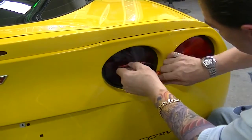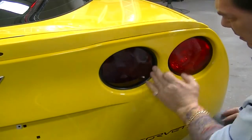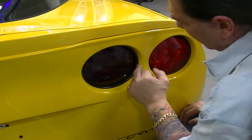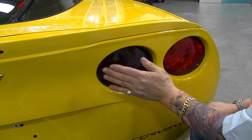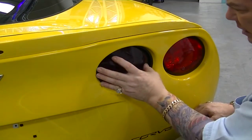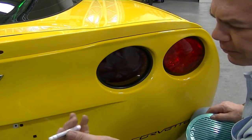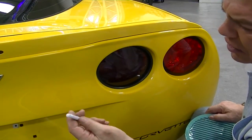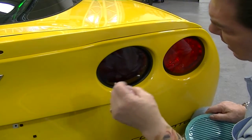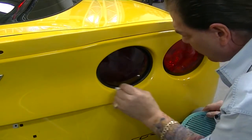If you happen to have a pruning shear that works, you're just going to put that in there like so. Now that gives you a nice mounting surface for the new cover. The reason why we're doing it like this is so that our covers sit in position nice and straight like a true billet grill — that's the kind of effect we're looking for. Once you've got your molding in, you're going to snap the little glass vial in here. It's going to release the fluid onto this little felt pad, and that's going to allow you to apply the adhesive promoter right on the edge like so.